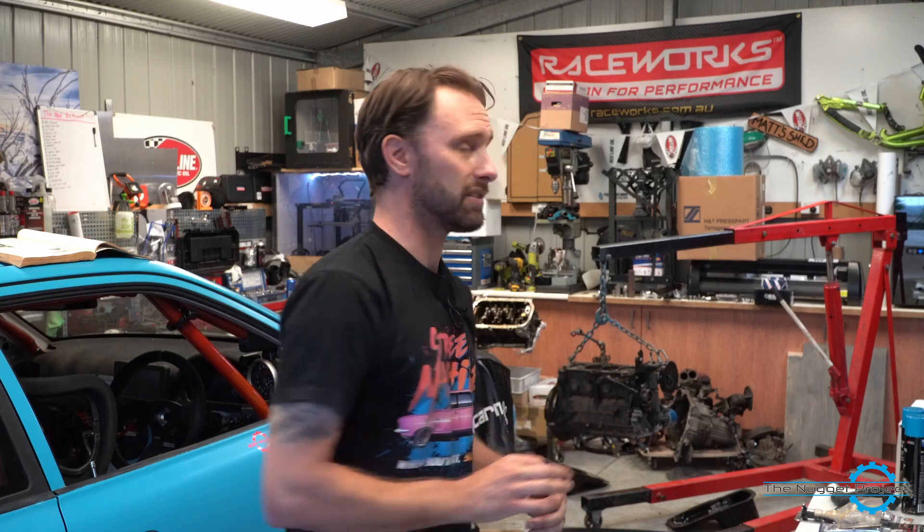I've got a new timing belt kit and new head studs — which I have to do anyway because the head studs are torque-to-yield, meaning once you do them up they stretch and that's it, you chuck them out. I've also got a new head gasket. Adam Macro rang me today — he's a legend — and gave me a bunch of advice on how to measure up the squish, the pistons, all of it. He sent me videos on how to do all this and where to drill for engine sealing. Thank you Adam, you're a gentleman of the sport.